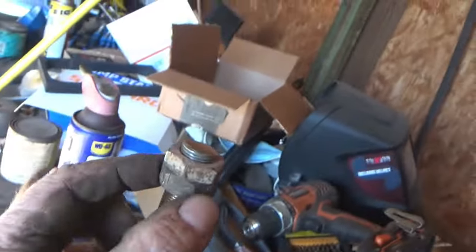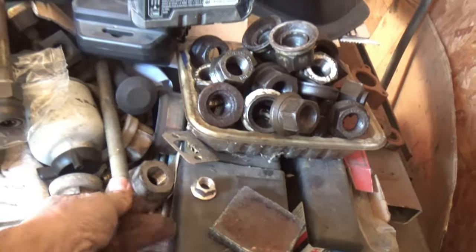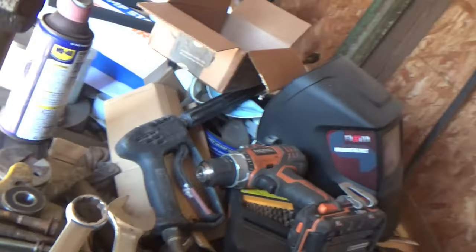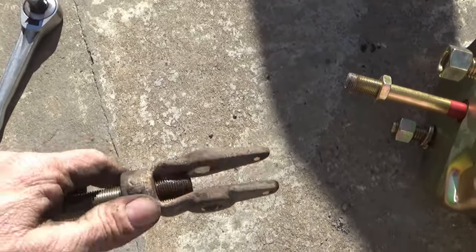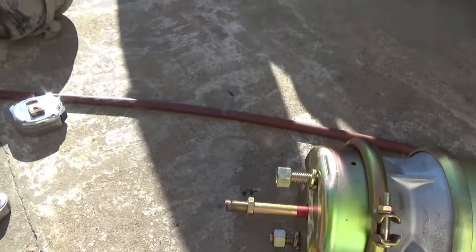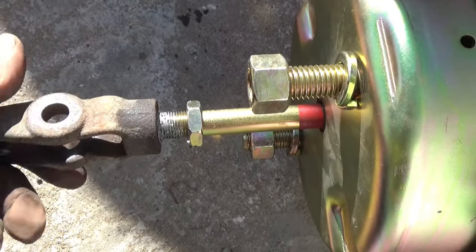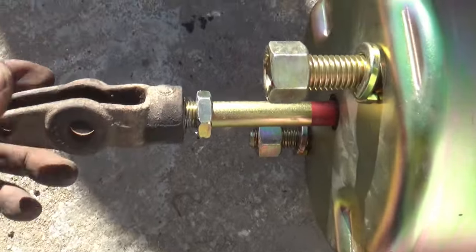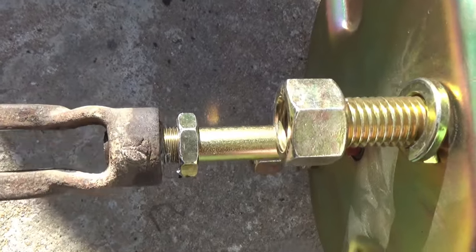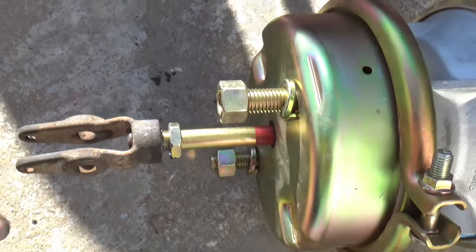I got it started in the vise with two lock nuts — the old one we just had, and another rod from somewhere in the past. I unscrewed that and locked them together with two wrenches, then tightened it down with some spray oil in there to chase that thread out. We got that all cleaned up — it spins on freely now. I put a little bit of anti-seize on there. We'll probably end up doing this again someday, even though this truck is about 25 years old. We want it to come out just a little bit past the bottom — we cut it about an eighth of an inch long — so there we go.